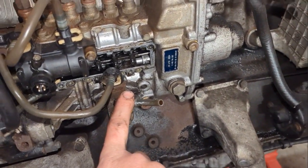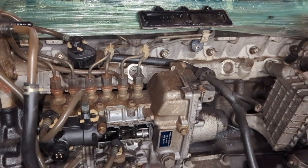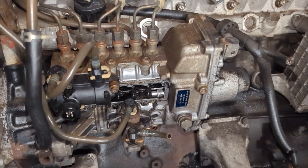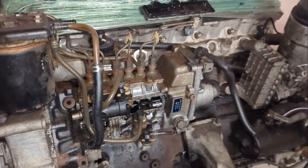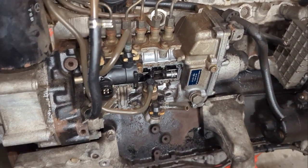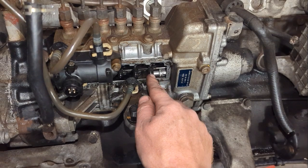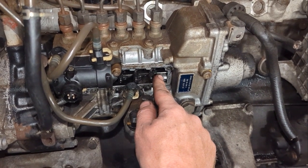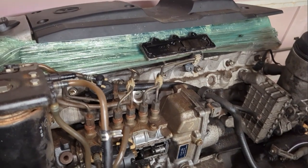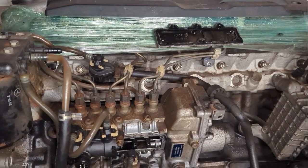Connect your fuel from here, and the return line — connect that too. Then crank it without glow plugs, without starter fluid, and just crank it for a while until you get fuel in the whole system. I also like to use a little low-pressure lift pump — not everyone has one, you don't really need it, but it saves cranking time. When I'm ready for it to start, I'll take the socket out, turn it sideways so it's just a couple millimeters forward, then spray starter fluid in the inlet — or if you have the manifold on, spray it right there. A quick spray across all the intake ports and then you start it.